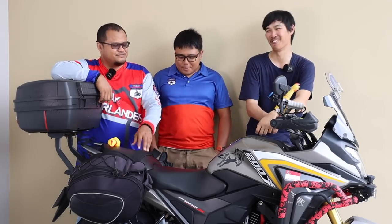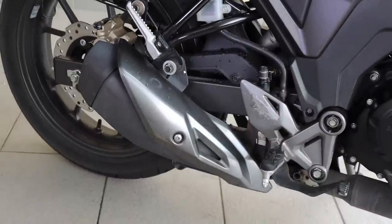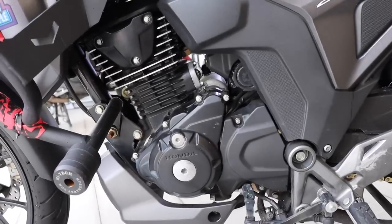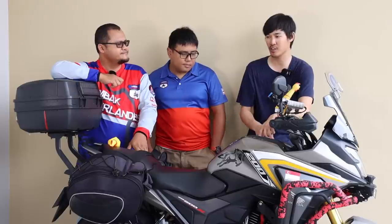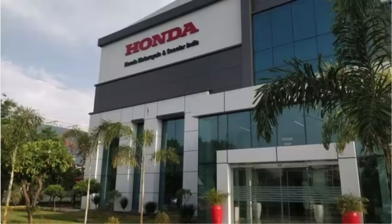Class 2A. Yes. So, okay, in your experience maintaining this bike, how is it? Not too bad. I didn't have any problem whatsoever. I got no major problem, only a minor one. The O-ring of the neutral switch, which is inside here, this plastic thing, the O-ring degraded very fast. When I got this bike, 1 month later, I went over to the shop, and they said, hey, this one is leaking. So they took out this panel, then they checked. Coming from there. Then they took it out and said, oh, your O-ring disintegrated. Like, when you touch that, it just breaks apart.